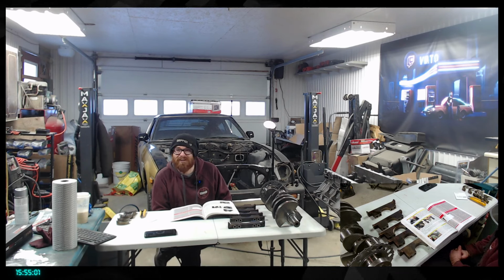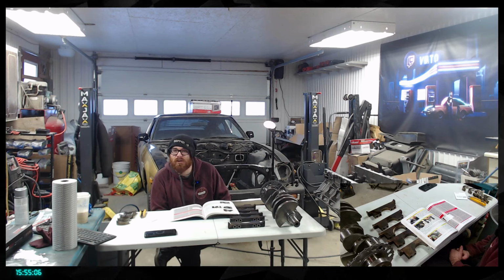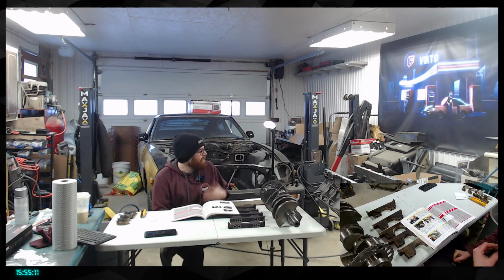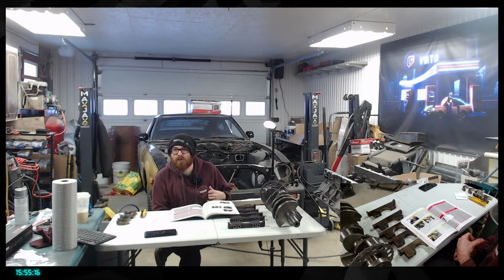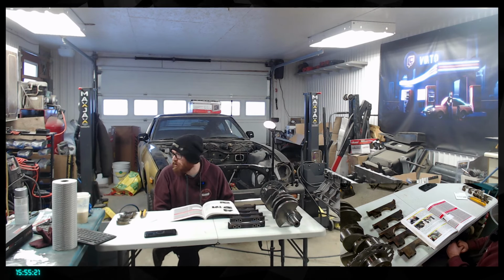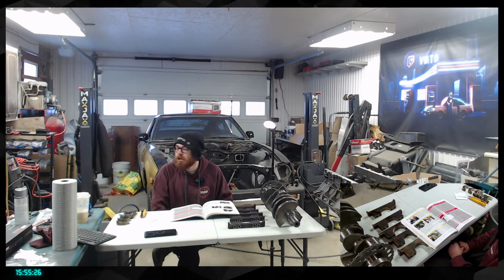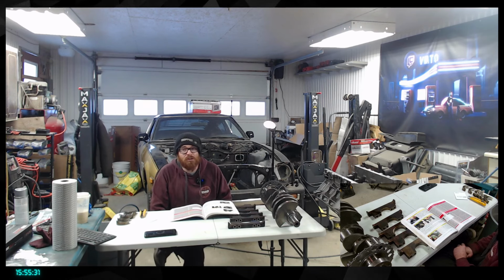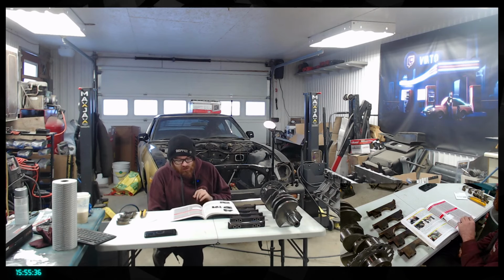And a new fan. I almost did it to my Wrangler because of overheating when just trail cruising. Usually you can go with just some proper cooling. In here, we're going to have a three-row radiator for the cooling system, plus a single big fan with a custom shroud I'll probably make. That's the idea here. The fan is over here somewhere. It's there. So we're going to be using that, and the fan will be plugged straight into the ECU, which means the ECU will check the engine temp and turn it on when it needs to. So that's going to be really cool.